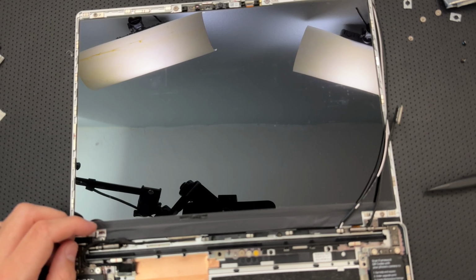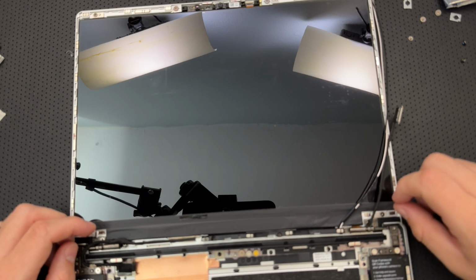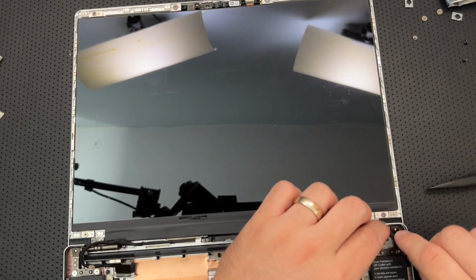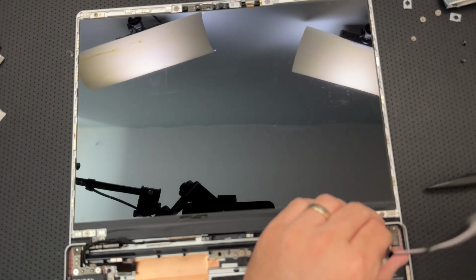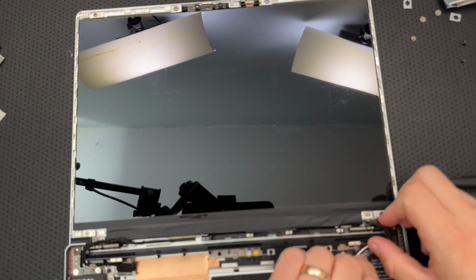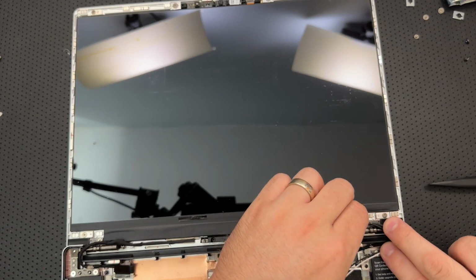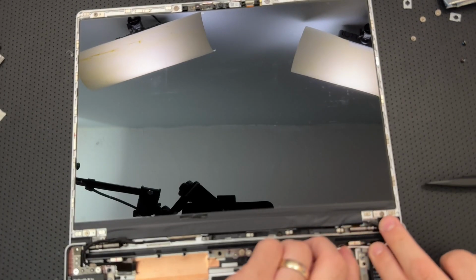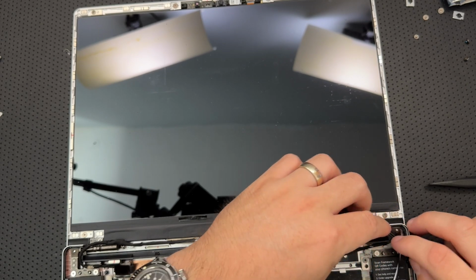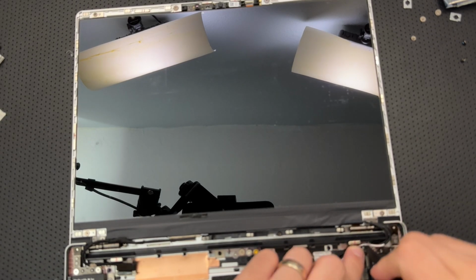Now, I also need to redo the Wi-Fi antenna cables over the right hinge, webcam cable over the right hinge. Okay, so that's both of these guys going through here, around, over the right hinge, and under. And I assume into that little gap, but all right. So that's all there. Beautiful. All right, at this point in time, we have reconverged with the original instructions for reinstalling the motherboard.